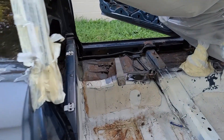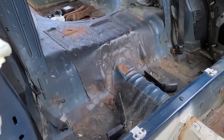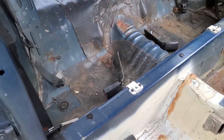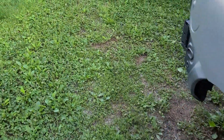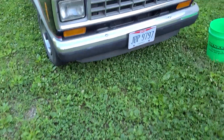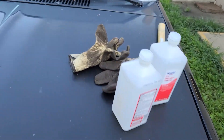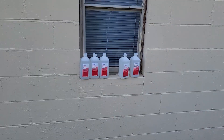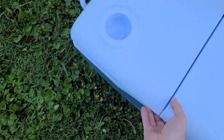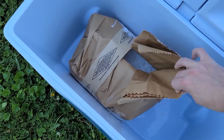Today, as I talked about last time, we're going to be taking the sound deadening panels off. You can see those black patches right there. Those are actually made, I believe, from tar and coke. To do that you're going to need isopropyl alcohol, gloves, a rubber mallet, more isopropyl alcohol, and the fun stuff — about 20 pounds of dry ice.